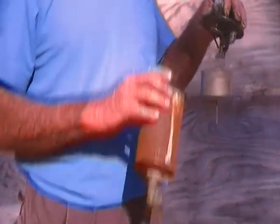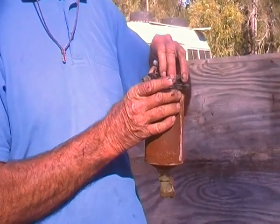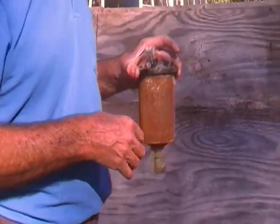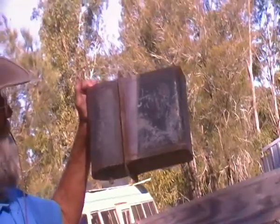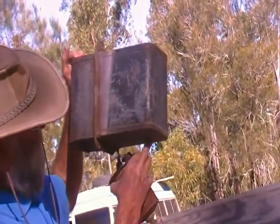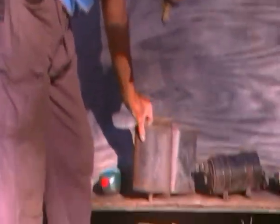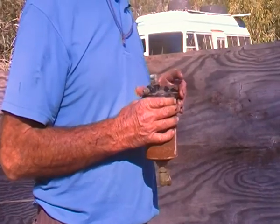I've got to do a few other things as well, but that's the vacuum tank — that's what they have instead of a fuel pump. It's quite a simple and easy mechanism, which overcomes basically gravity feed. This is inside the firewall on the Lincoln. Because it's a V8 and the carb is in the valley and it's updraft, there's not a lot of fall — probably only about six inches at most from the bottom of that tank to where the fuel goes into the carb. So it's not a lot of fall, which again works against it going up hills.